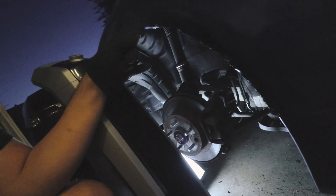I don't know how long it's been exactly, but it's dark out now, so it must have been a while. I've encountered a bigger problem than I thought initially — I thought it was just a small spot of rust, but this whole fender well is covered in rust up to about here, and around that deep. What I did was I opened it up and got as much of the rust out as I can. So this is two pieces right here. I sanded it down with 60 grit sandpaper, tried to get as much off as I can, and since it's exposed metal now I just painted it black — this won't matter because it's on the inside anyway. Now I have two sides of the quarter panel open and I need to combine these, put some bondo over it with a mesh. I bought a kit, so I'll show you in a second. I need to have this part closed and then we should be good.